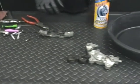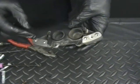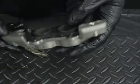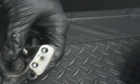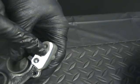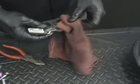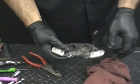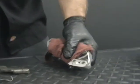And on the other half, we're going to do basically the same thing. Two pistons. We're going to put the air in this hole where the O-ring was, because we don't have any fitting where the line was, since the line was on the other half. We're going to put air in here. So we're going to do the exact same thing, and we're going to pop them out. Again, I try to wrap a rag around there to kind of keep them from flying across the garage.